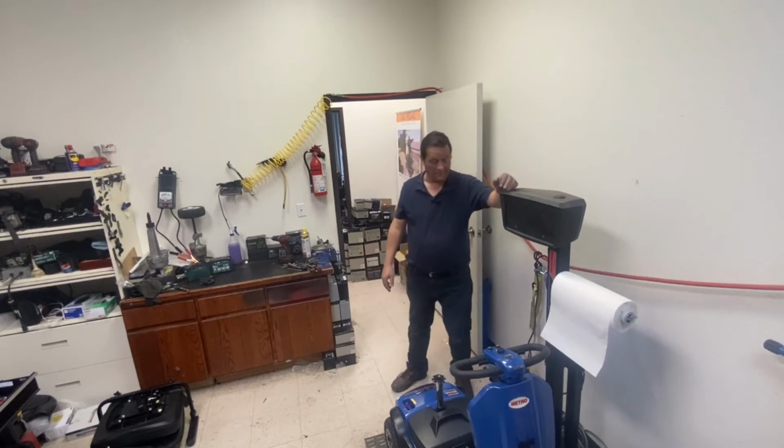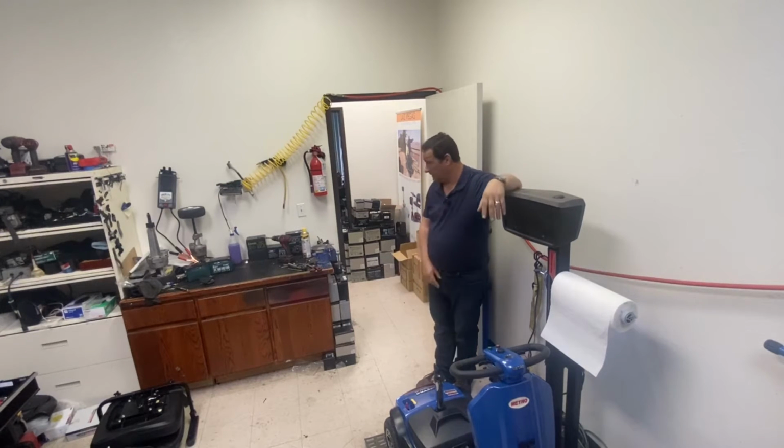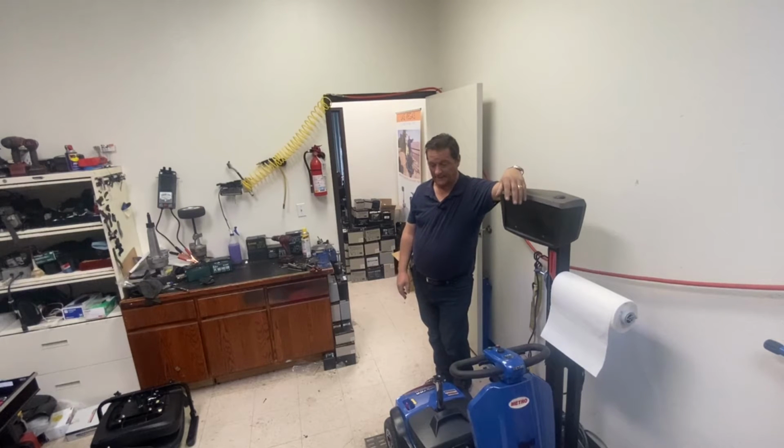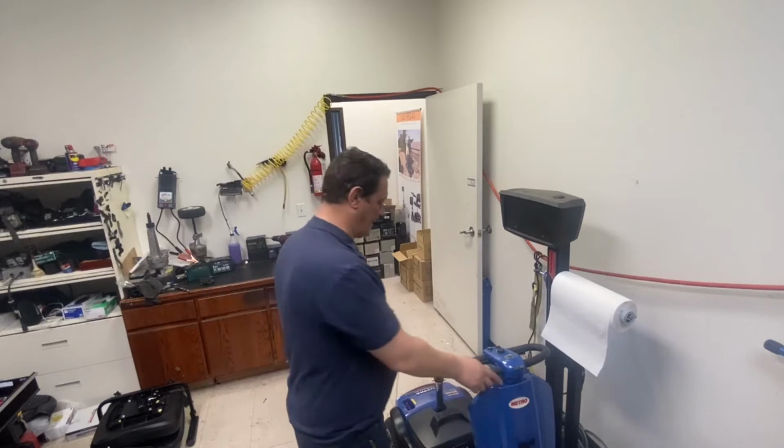So anyway, he cleaned it, brought it back, put new batteries in it. He got some kind of liquid ingress into his charger as well. He had batteries not long ago. They're actually in there. I think the liquid on the charger was causing him charging problems. He said he's not getting any battery life. I did a load test on the batteries, they're fine. It's more than likely the rot in the charger cable. It was just all powdery and you can see the corrosion on it. It's never going to work correctly when it's like that. But anyway, that was yesterday's fun fact.